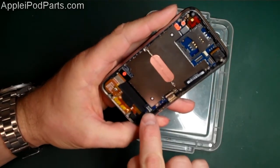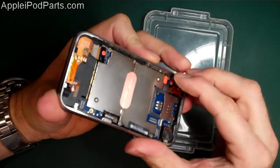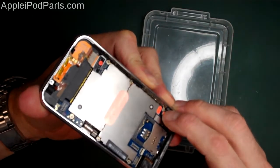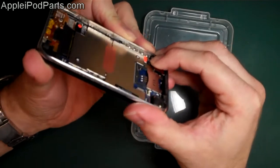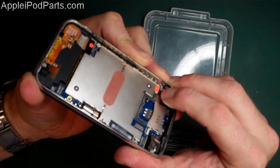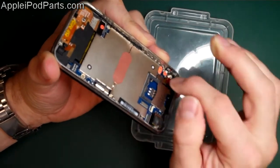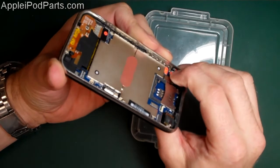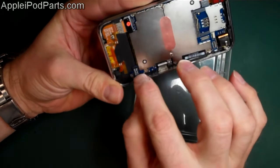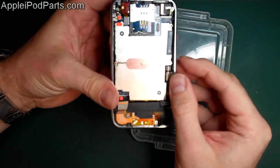Now number 6, and also I think it's number 7 down here on the 3GS, is really tricky - the circular connector. It's good to get a good angle at it - have a look with your finger. There's not much margin for error. It's a case of having a good look down there, finding where you are before you even start to put any pressure on. If you get it somewhere near and located, it does give a nice little click on. If you try and force it thinking it's anywhere near and it's not, you will peen it over and you're into a world of pain. You're into trying to reform the little circle and all sorts - they are so fragile, so be really careful with those. Same with the 3GS one down there as well. Once you've lost those, you're going to lose your signal and your aerial integrity.